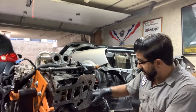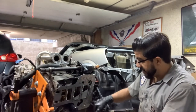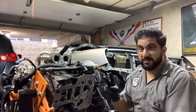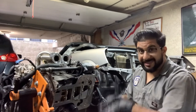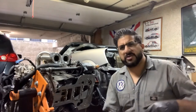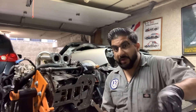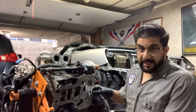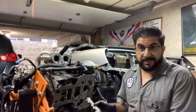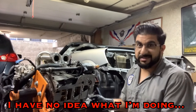What we get with the Ishihara Johnson crank scraper is a much nicer version. Each of the baffles has an area for oil to drain from various locations to minimize what gets splashed up. The idea is twofold: keep oil in the pan, and also prevent it from flying onto the crank. There are also little channeling pieces — no instructions, but there are pictures on the website.